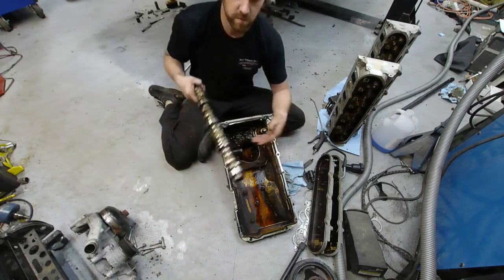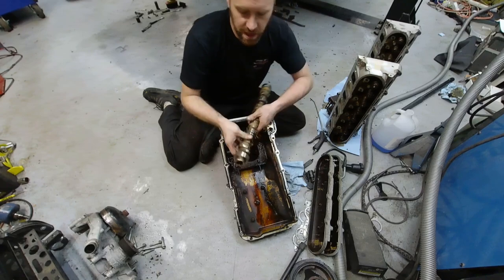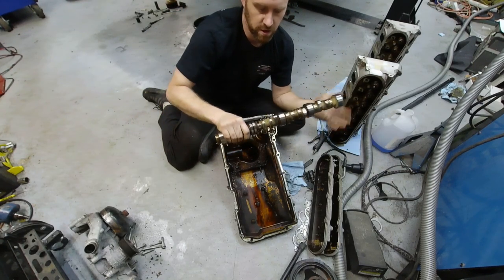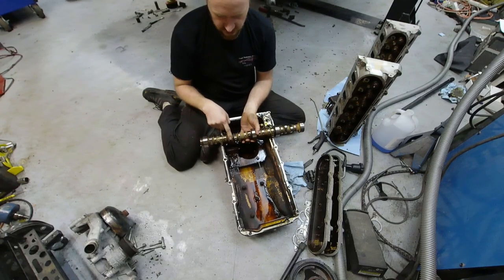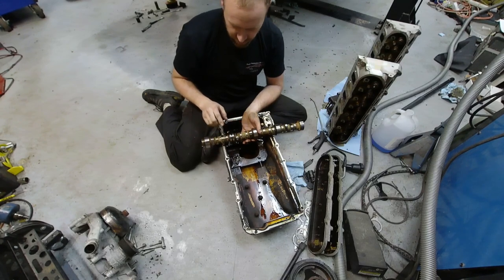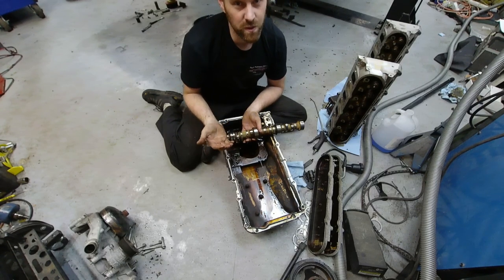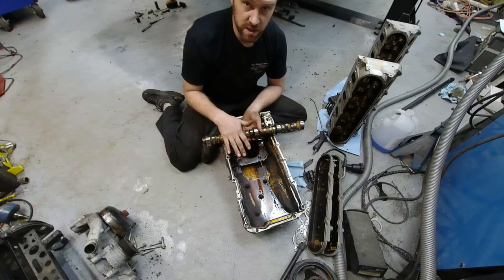This one wiped out the cam. This is cylinder one, intake valve, and the camshaft. It actually has a pretty nasty groove worn into the first lobe here. The second bearing surface here — for the variable camshaft timing — has a little bit of wear, and the bearing has some score marks in it. This is going to cause some oil pressure loss in the vehicle.